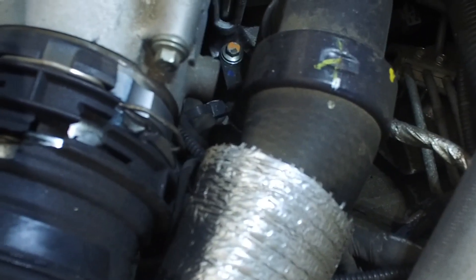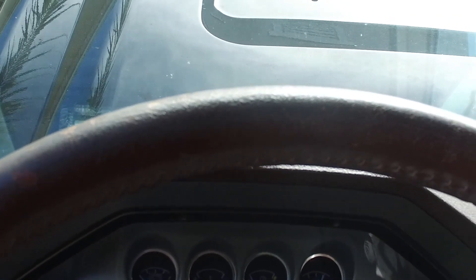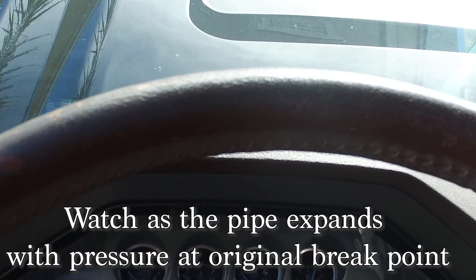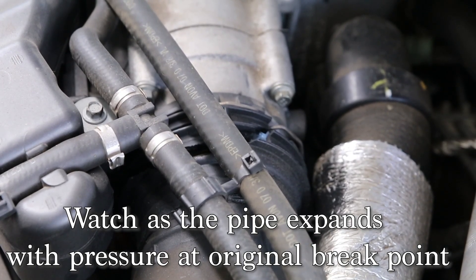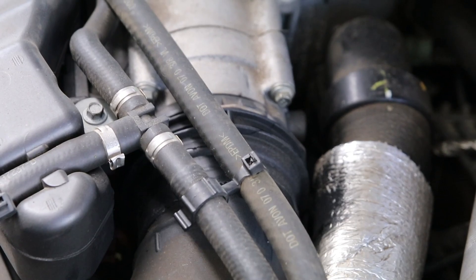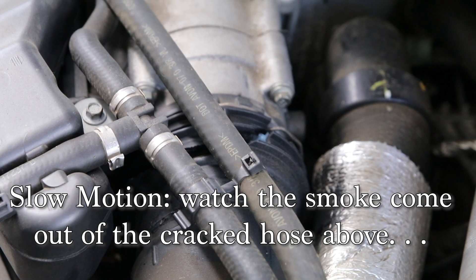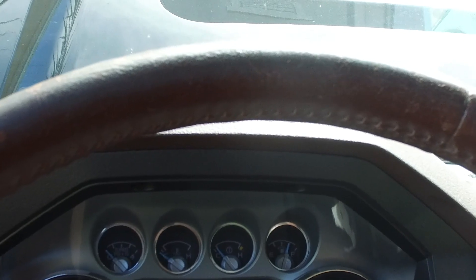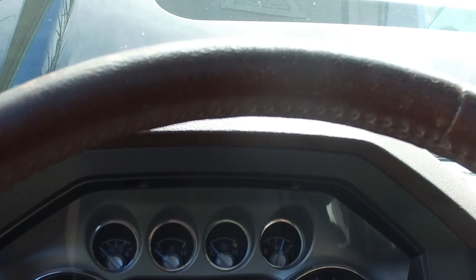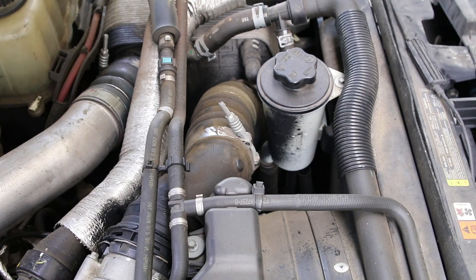Before we get to the replacement, we're going to crank the truck up and let you have a look at what it looks like when that happens. When I try and drive, the turbo doesn't go up. You can hear the air start leaking out of the hose out there. The truck is not responding well to not having the turbo. A lot of people report black smoke out the back. It does in fact limp along after this happens, and the engine is very close to dying.